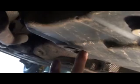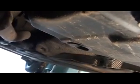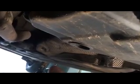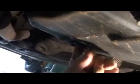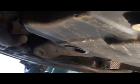Put it in a 1 gallon bug sprayer. Take the hose, chop your valve off and get you a piece of like 3/16 inch brake line about 1 foot long. Bend it into a hook so you can stick it up in here and hook it. And it'll go out there, and then you pump until you see transmission fluid running out. Once you see transmission fluid running out, take your hook out, stick your plug back up in there, you're good to go.